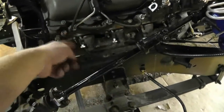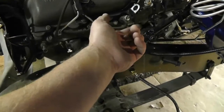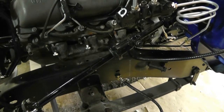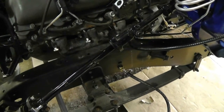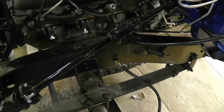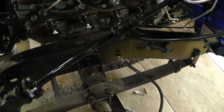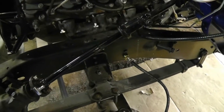I'm going to see if I can get the front brake lines done. It should be pretty straightforward — just one line that runs across the crossmember underneath to the other corresponding line with a T at this end. There's a brake line that's covered with what looks like a big spring, and I'm thinking I probably should be using that for the front part because it's going to be rattling against stuff all the time — it's just abrasion protection. I'll do it with the 3/16" line I have right now and just not worry about it for the moment.